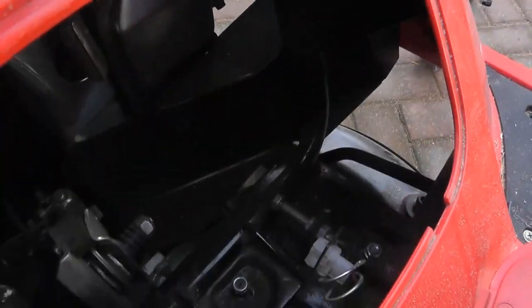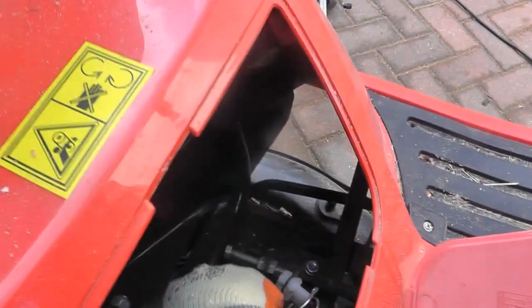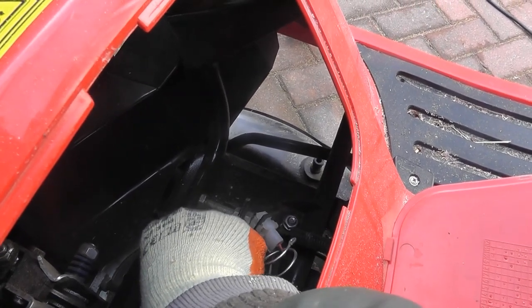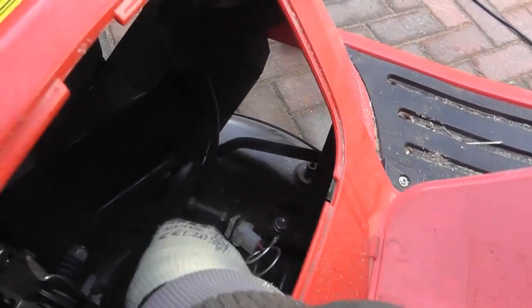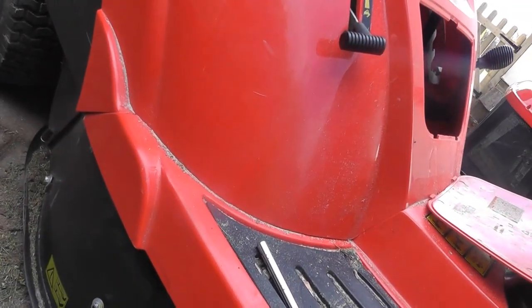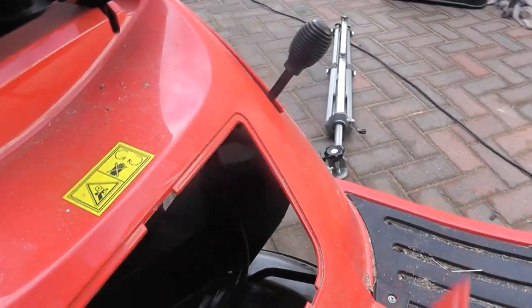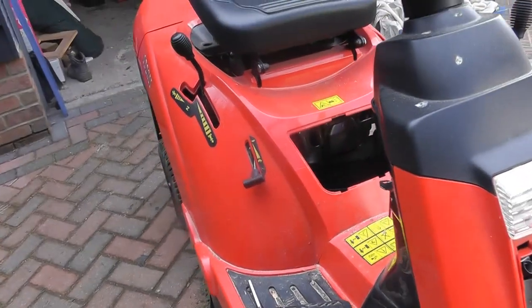So, as I said, you need to take this one nut here out in the middle. This is a 13mm. So I've got mine fairly loose now. Okay, so that's coming off there. That's a 13mm nut. You've got that. Pull that to one side. Okay, when you pull this up, I'm just going to put this back on the tripod, and then we can pull up. I'll show you how to do the top.